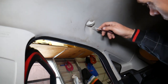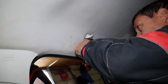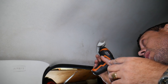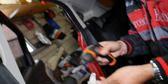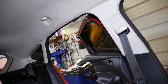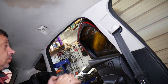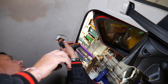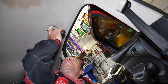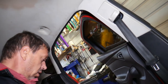Now we're going to open that cover right there and remove a screw — probably a Torx 20, just like the sun visors. That clip is out. Now we have one on the other side — this is on the driver side. Remove that cover and remove one more screw. We need a little bit of light. Perfect, this one is coming out as well.